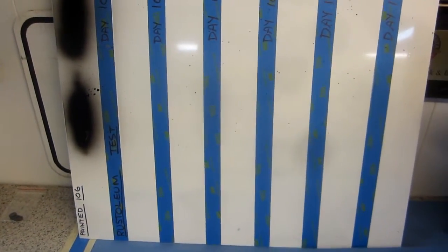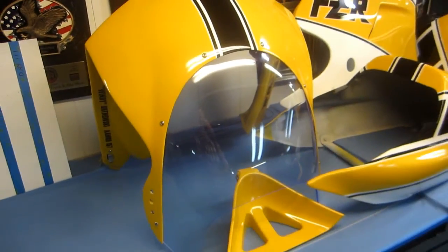So now, just to show you another reason it pays to do the test. As I look at this part, I can see it's got cracks in it. I don't know if you can see it. That's paint, a different kind of paint issue that you have. When you mix and match paint, that's an issue. Now, you wouldn't believe it, because look up here, it's beautiful. But you always run some giant risk when you mix and match paint. This is a wonderful lesson to learn.